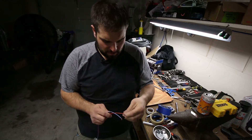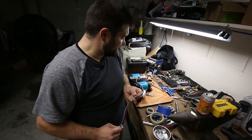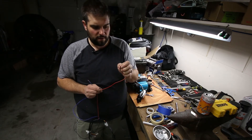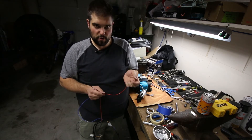These two leads go to ignition switches basically — this one is used for the LED portion of the indicator light, which I'm actually not going to hook up because I don't want a light shining at night constantly. This one's going to go to a power point on the fuse block so that when the fuse block is fired up, the compressor will be active.